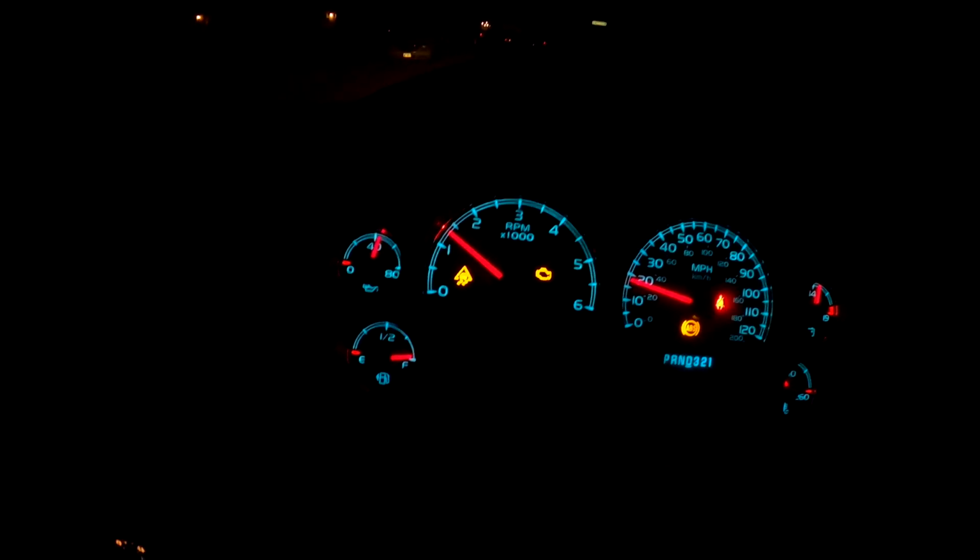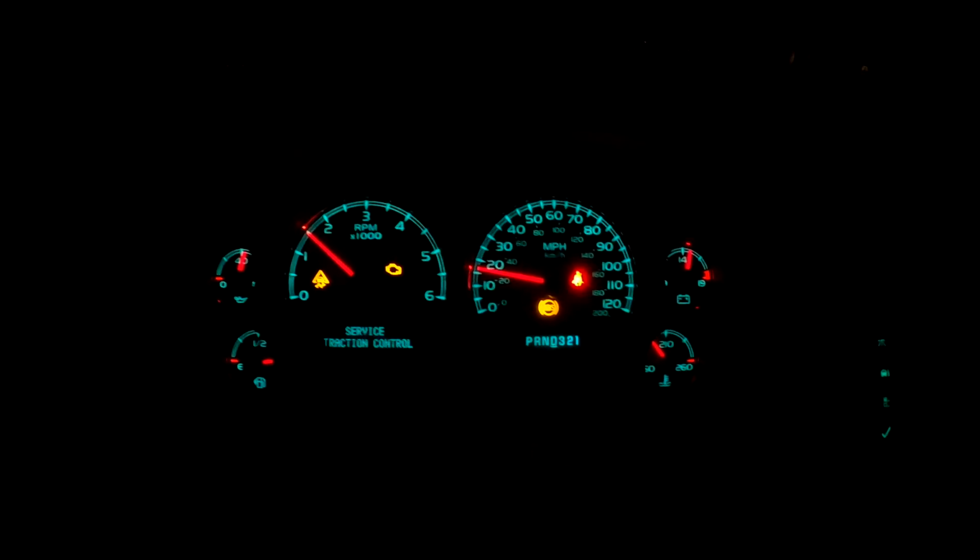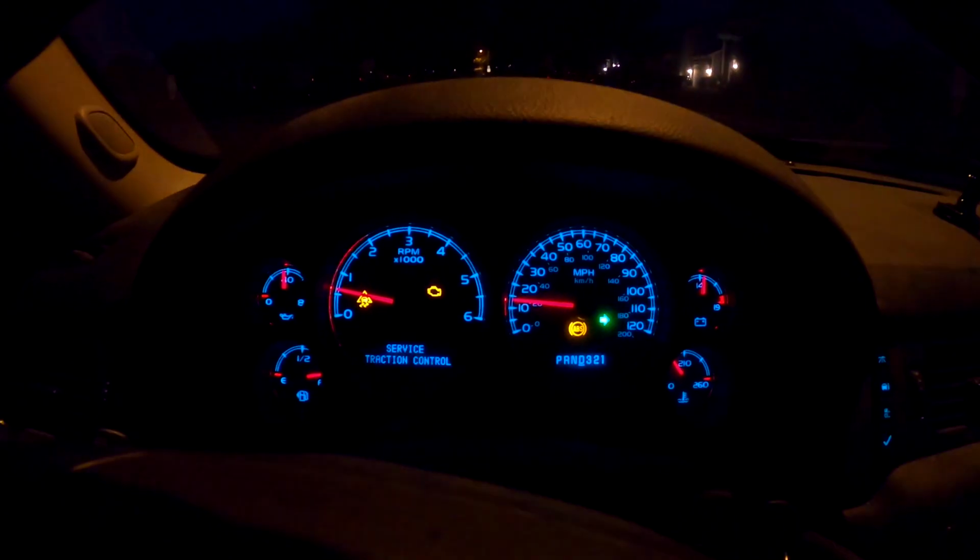But yeah, I got some work I gotta do on this thing. It's got some traction control because of some wheel bearing wiring that got screwed up before I put the wheel bearings on it. When driver's side wheel bearing went out, the ABS light is on because of that as well. The check engine light is on due to oxygen sensors that I replaced. And he ordered, I thought he ordered Delcos, but I'm not sure. I'm pretty sure he ordered Delcos, but for some reason they went right back out like 3 months later. So I got to swap the oxygen sensors again. So he'll pass emissions next month. The oxygen sensors I'll switch, and then I'll take care of the ABS stuff later.